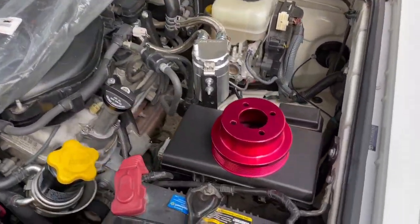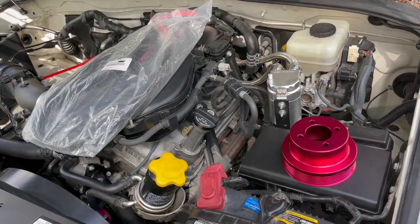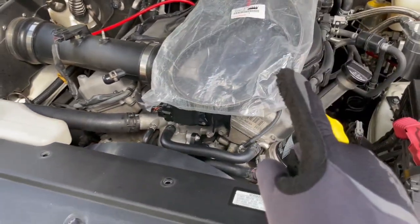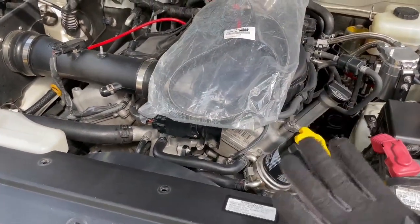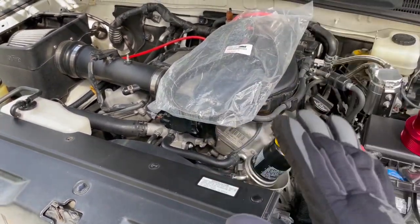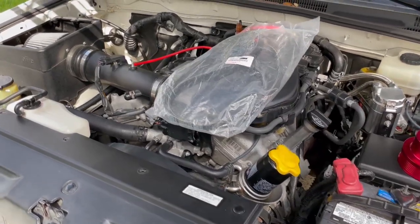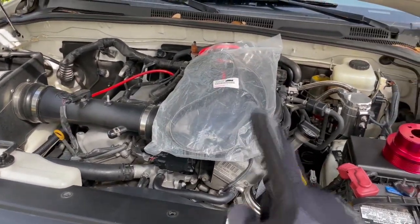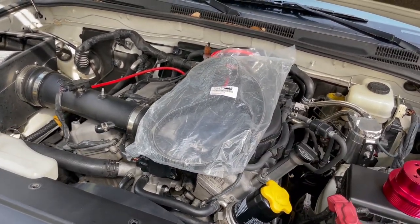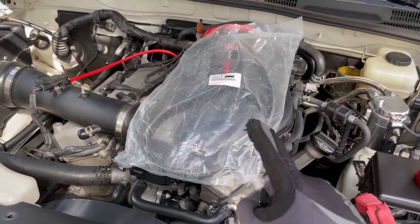This video is going to be a two-in-one. We're going to be doing an engine mod as well as a maintenance procedure, but the main focus is the maintenance procedure. Going a little bit into both parts, I'm going to start with the serpentine belt. When it comes to changing the serpentine belt, you're supposed to do it at every 90 to 100,000 miles. However, when I hit 100,000, I didn't change it — I kept it as is and the belt was running pretty strong. Currently I'm sitting at 155,000, and in all honesty I think I'm pushing it, so it's time to change the belt. However, there are some Toyotas out there that have reached 200,000 or even 300,000 miles with the original belt, which is pretty good, but I'm going to play it safe and change it now rather than risk something happening down the road.